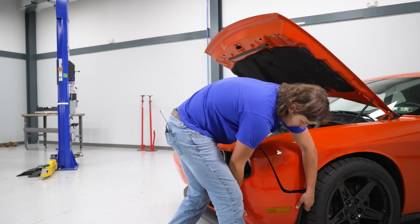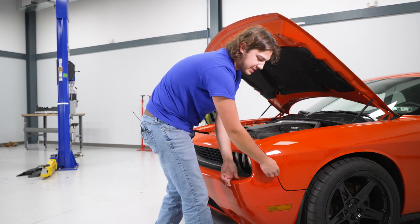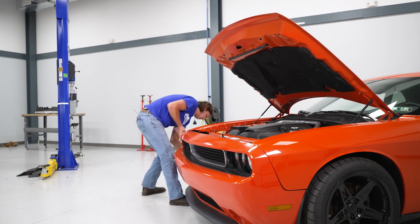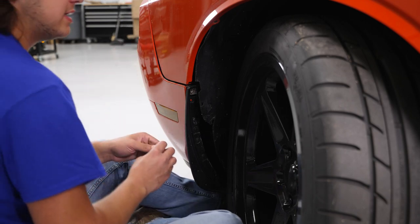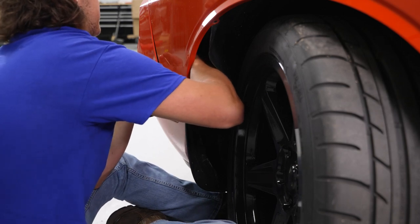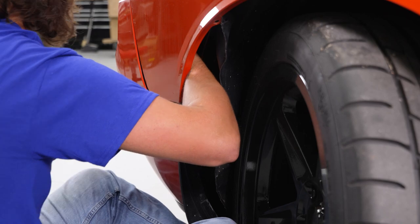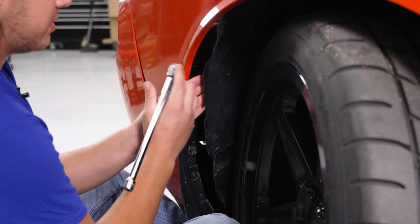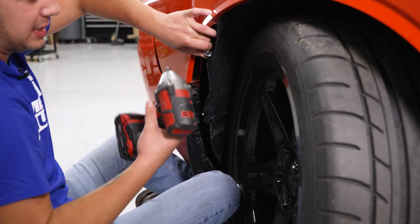Come over to the side and try to line your bumper up. Don't worry about any gap because there is a stud with a nut we're going to tighten down. Get our nut onto the stud located up in the quarter panel area — go up in the quarter panel and thread that nut onto the stud. Then take a 10-millimeter swivel socket and extension, line that onto the stud, grab an impact, and tighten it down.